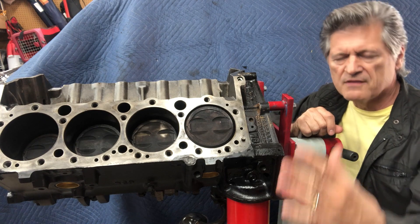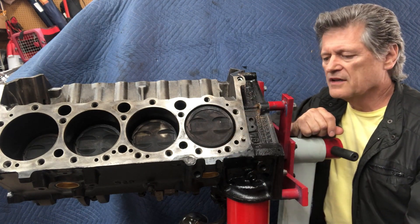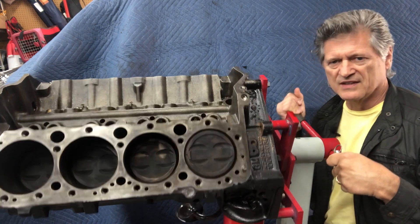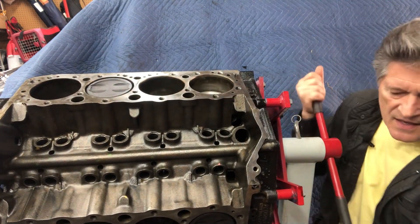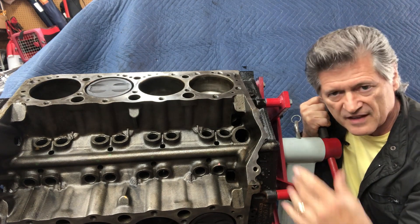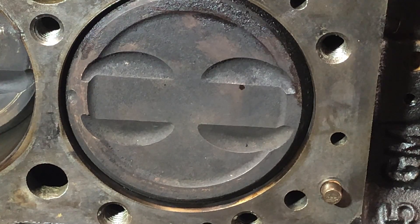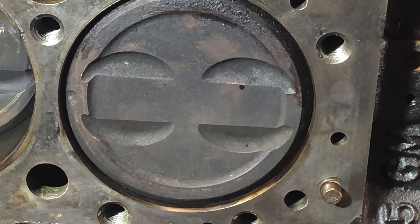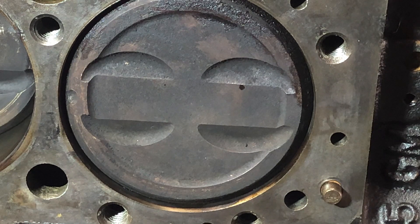We're basically going to be using some chemicals and just a really mild brush to dissolve this carbon and flush it out. The concern with doing this is you don't want to be adding more contaminants down around your rings and into the lower end of the engine. So the first thing I like to do is get the engine oriented where everything you're doing is going to be going out. We're going to turn this about 90 degrees and lock it in there. We'll be spraying and putting all our chemicals in, and hopefully everything is coming out. We're also going to take a few steps to clean out those cylinders when we're finished. When we see everything go back to that nice dull silver, we'll know all the carbon and exhaust byproducts have been successfully cleaned up.